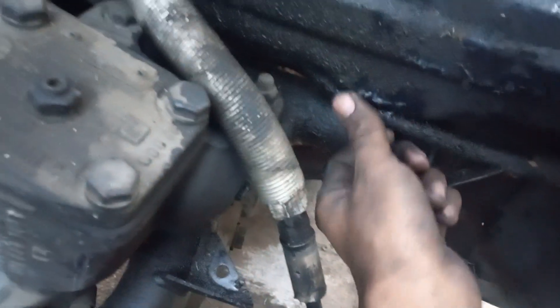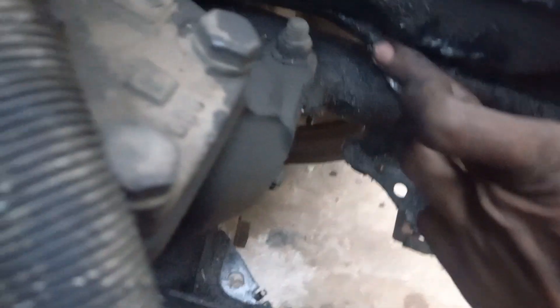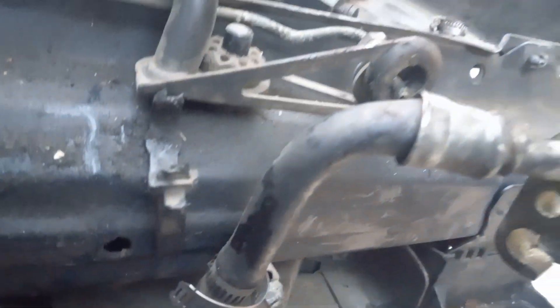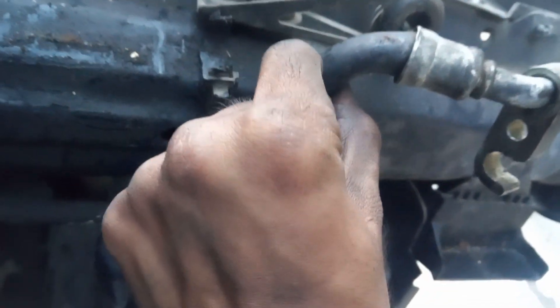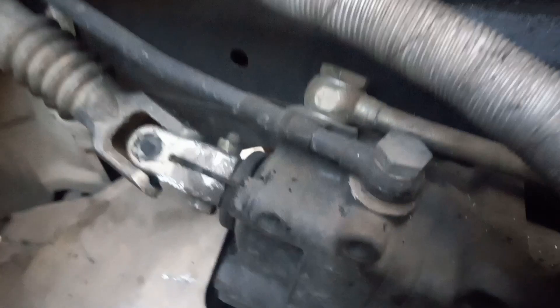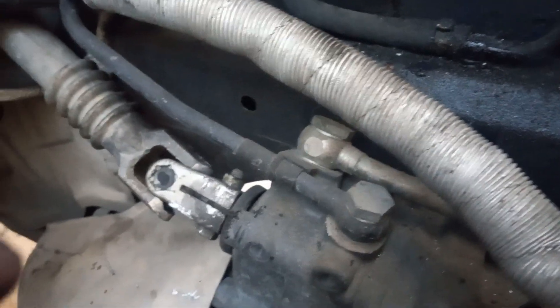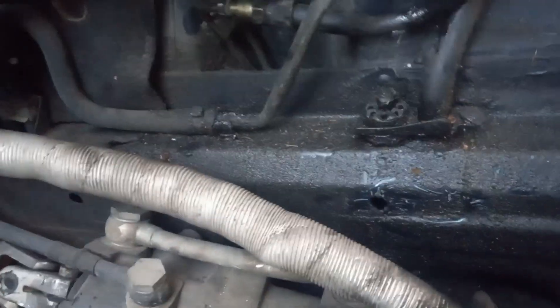You can see what generally looks like steering box lines, but as you can see behind all the sludge it's actually a hard line up until here. This side will get cooked but nothing can really happen here, and these are not disturbed, so there's no reason those banjo bolts and crush washers should be causing your leak. Moreover, this hose has a significant amount of heat shielding — if you've got your motor out, why not address it.